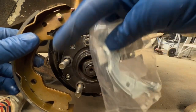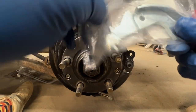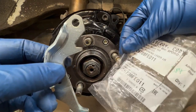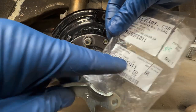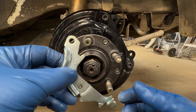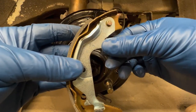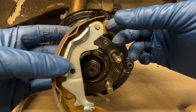Essentially, it pivots on this pin, goes around, and clips into your parking brake lever. These are directional — there's a left-hand and right-hand side. The part number I gave is for the left-hand side; you can see it says LH right there. This down here will clip into your parking brake lever, but first you have to put it on your shoe. It goes on just like so. Put some grease here, and then there's a small C-clip that goes into that groove to hold it in place.